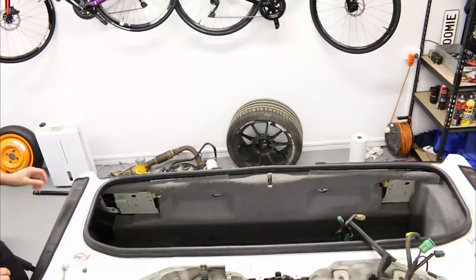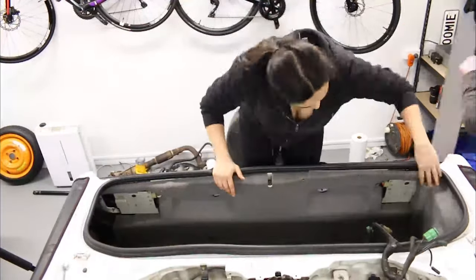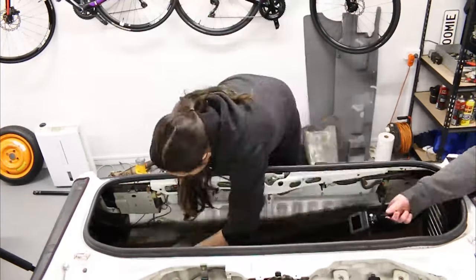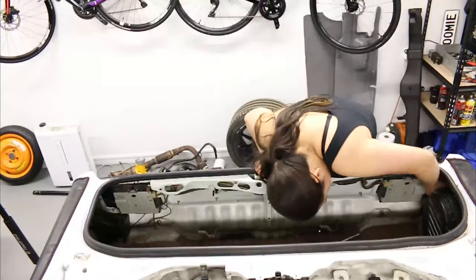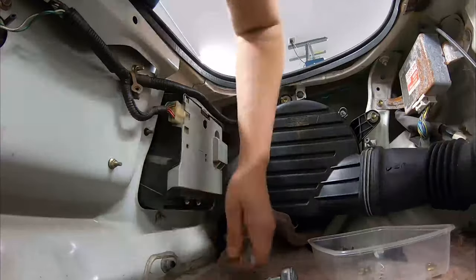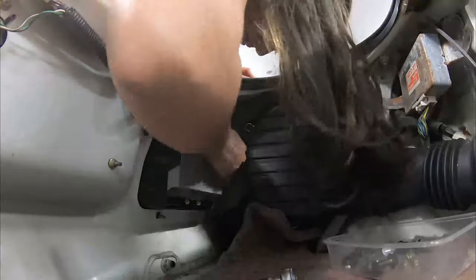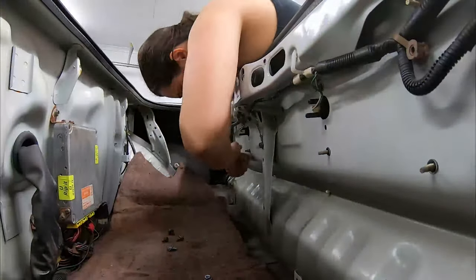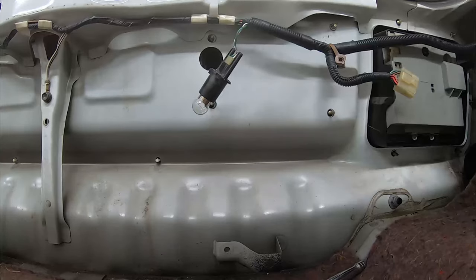Removing the lining was pretty simple as none of the parts were affixed. However, I do believe that from factory they are all held in with plastic clips. Once the lining is removed, you will need to remove the intake, which is held in with a couple of nuts, before then removing the 8mm fasteners holding on the taillights. There's a lot of them, so be sure to double check you've removed them all. After that, the taillights should pop out with not much resistance.